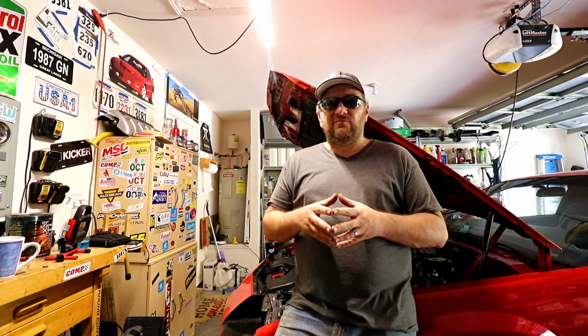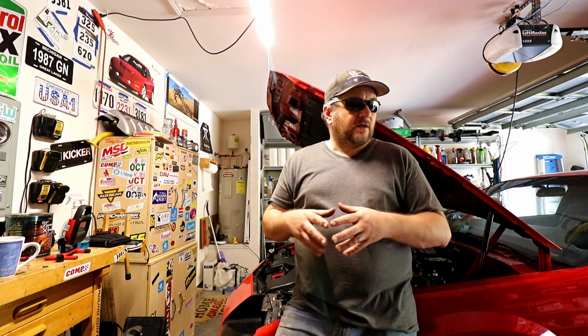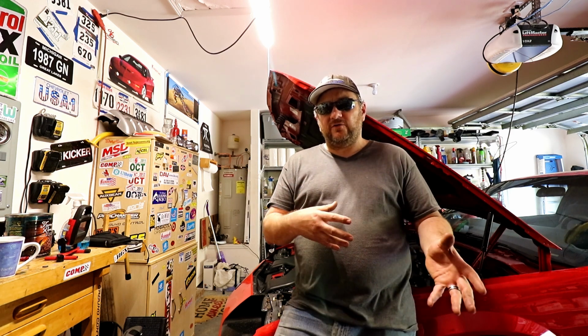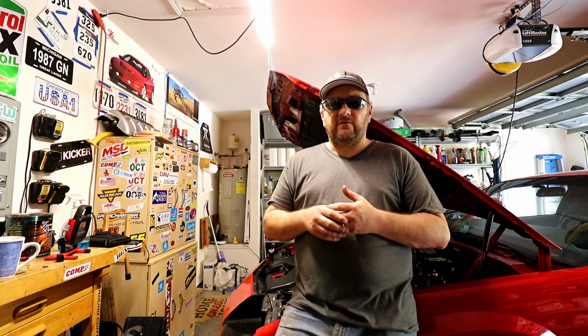Right now I've got a lot going on, so I'm going to try to put out content as much as I can, but I'm busy going every which direction, and really don't have a lot going on with the car until a TV cable comes. I should have something shortly. Put that cable in, do some data logging, figure out why the idle is crazy, and maybe we can flash something in here, or see if the idle air control valve's not working or working too much. I don't know.